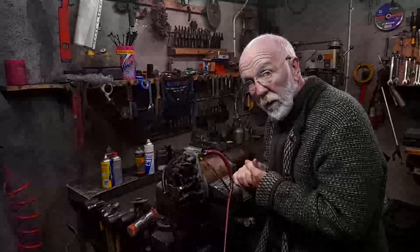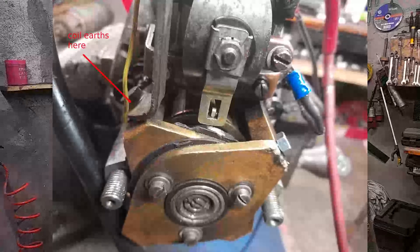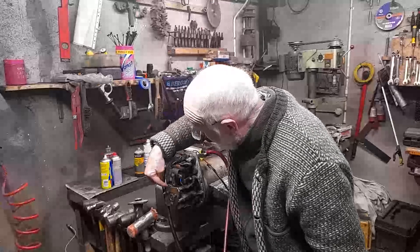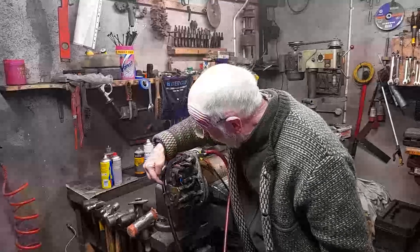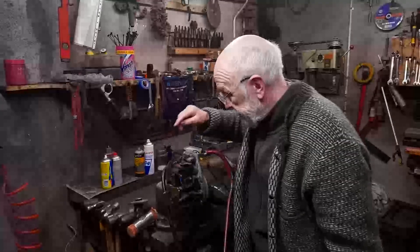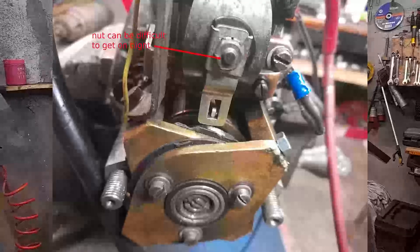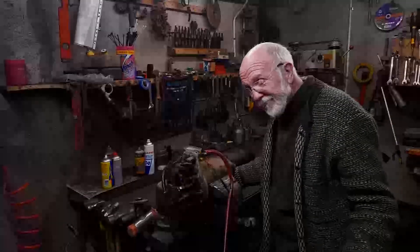We've actually got this starter working now. We discovered two problems. One, we had a bad earth on the wire. Whenever you push the button, current flows through that little small terminal, down that yellow wire, into the coil, back out of that other yellow wire, and back down onto the negative. That plate there is always negative, irrespective of whether you've pushed the starter button or not. So we had a bad earth there at that screw. This little nut here at the front has to be on sufficiently tight to bring the whole lot up together. As we say here in Ireland — it ticks the old dog for the hard road. Thank you so much.